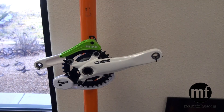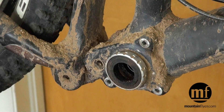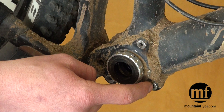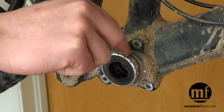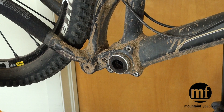There are a few things you'll need to know about your bike and your setup in order to pick out a chain guide. First, figure out if you're going to go with a single ring or a dual ring guide. Next, you'll need to know what size chain ring you plan on using — in this instance we're going to use a 33-tooth chain ring. Most importantly, you want to know if your bike has ISCG05 tabs, ISCG tabs with a slightly smaller bolt circle diameter, or no tabs at all. We make guides that mount directly to the bottom bracket, so for pretty much any bike on the market we have a solution.